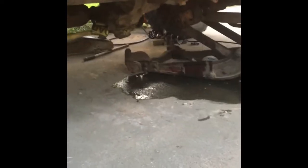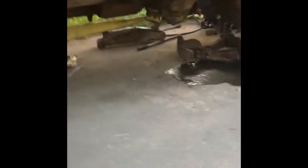When you get the transmission part of the way out and can't get it any further, just put a strap from the transmission all the way to the back and start ratcheting it. Before long the transmission will just slide on out and you won't have any more issues. Nobody told me this trick — I came up with it because I've been fighting this transmission for about 45 minutes. I got it as far apart as I could with pry bars and then ratchet-strapped it the rest of the way out. It's a little shortcut, but my transmission is out because of this ratchet strap.